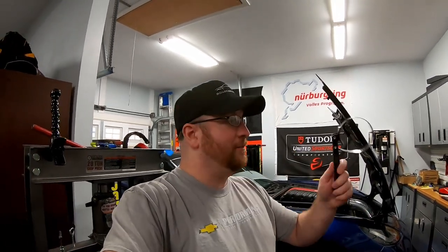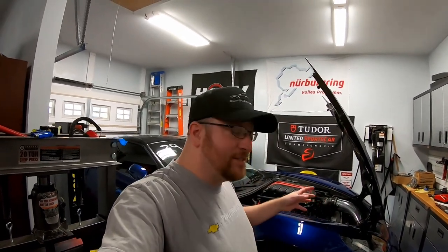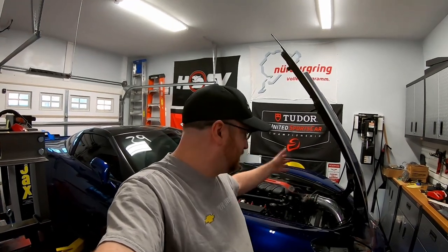You pull it, it tightens as you break it loose, and it comes off. I used a device like that for years and never had this much ease getting it off. The Corvette is a pain — you barely have a quarter inch between the oil pan and the filter, and probably 75% of the filter is surrounded by the oil pan. I'd definitely recommend this tool. Could you buy a more expensive version that slips less? Probably. But you just saw me effortlessly get that filter off in maybe two minutes.